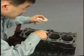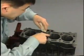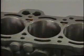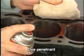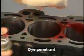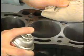The cylinder head and the cylinder block are inspected at the same time. First, check the cylinder head and cylinder block for cracks and damage. If the cooling water level is abnormally low, or if the engine oil is opaque, damaged parts are likely. Check for cracks and other damage visually or with a dye penetrant. Cracks appear as red lines like these. Similarly, check each connecting rod and the crankshaft for cracks and damage.